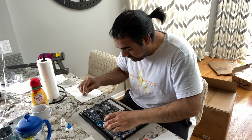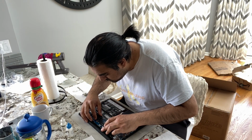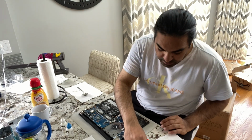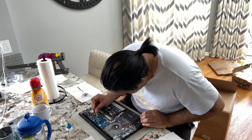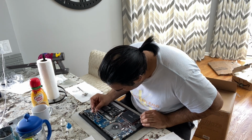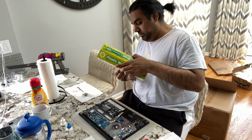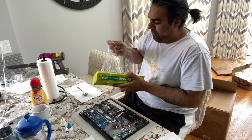I'm sorry, my phone died, so you went off camera for a sec. But there's only... Oh, I didn't put any thermal paste on there. I'm a fool. Okay, so this is gonna go directly. Just a standard amount, nothing crazy. That goes right on there. And at this point, I know if I have too much or too little, so I'm just gonna eyeball it.